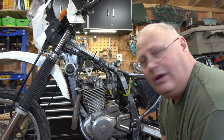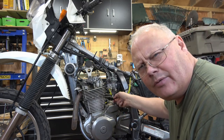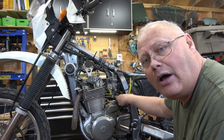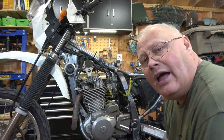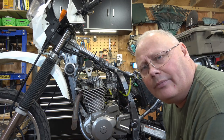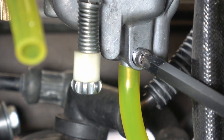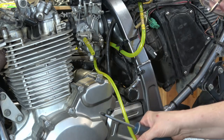Now that we have the gas tank off, what we need to do is actually pivot the carburetor itself to get to the float bowl. I am going to drain the carburetor — I forgot to put a drain hose on there anyway, so I will stick a bit of fuel line on. There is one bolt right down at the bottom that will allow me to drain out the carburetor bowl. Once that is done, I am hoping I can just loosen off the clamps and pivot the actual carburetor, though I may need to take the throttle linkages off again. Either way, I should be able to pivot it enough to get that float bowl off the bottom.